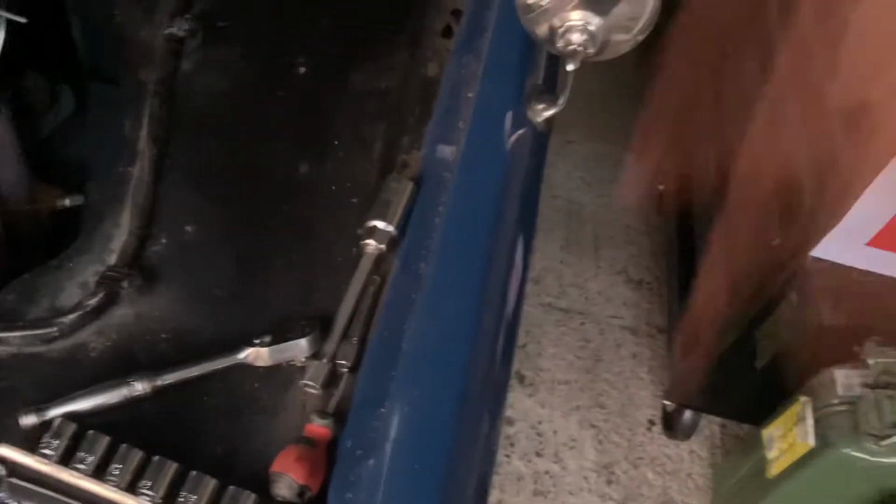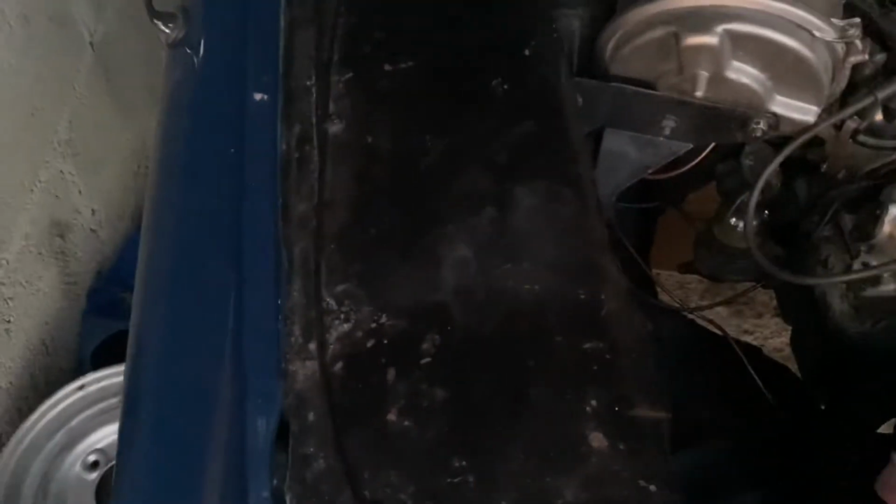But the issue is, if that side looks like that, and the passenger side of this car is the side that seems to be the most solid, then my issue is, if you can see, oh, sorry, the light is absolutely rubbish. You can see all this here, pitting and welding, that goes all the way along up there. I don't think anyone ever cut any metal out. I just think they went, whoosh, and then whacked a bead of weld across it and thought, yeah, that looks all right. So I'll have a look from underneath at some point. I'll get both these wings off, and I guarantee this side will be as bad as that side, probably worse.